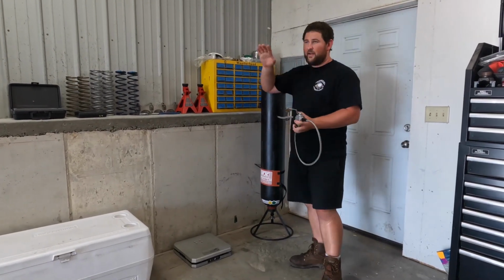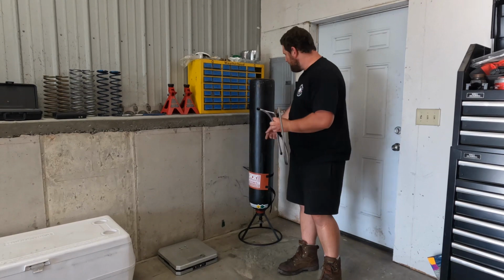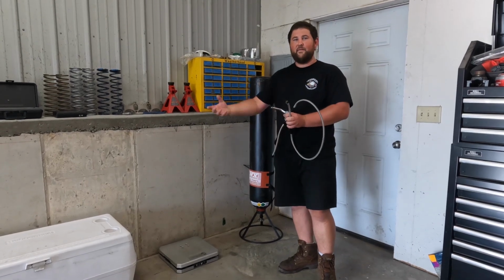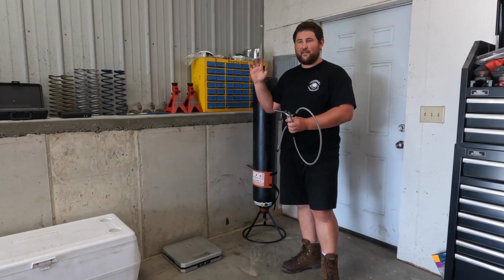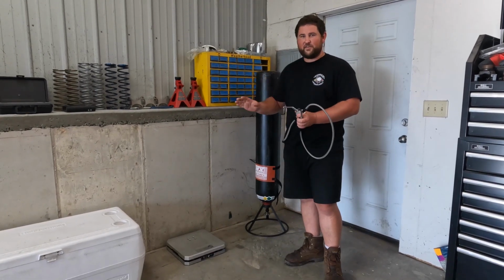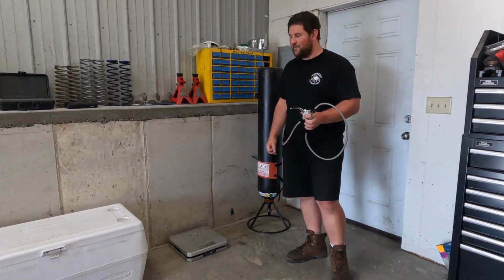Now, back to what I said about the pump station versus this style on what mother bottle you're going to get: this actually has a siphon tube in it, to where you can flip this bottle upside down like it is. If you get a pump station bottle, the bottle will have to be stood straight up, and if you try to extract nitrous like this from a pump station bottle, you won't get any nitrous, you'll just get gas. So you have to make sure that when you get this mother bottle, you get the right one for either a pump or a pressure balance like this.